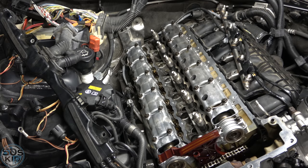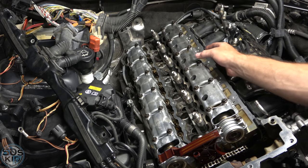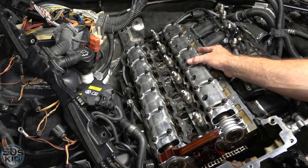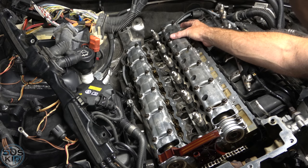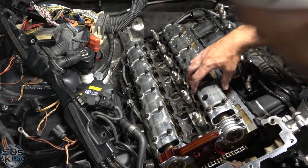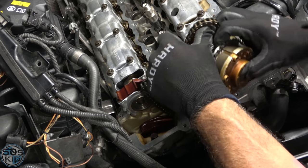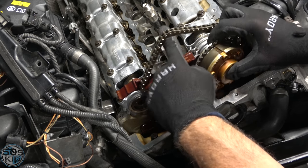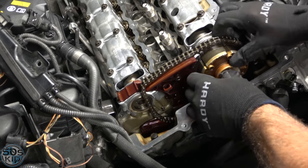I think these are totally fine. The fingertip test is the best — your fingertip can sense alignment on things; you can tell if something is off by a thousandth or so. These feel great. I've triple checked that all alignment feels good and all my rockers are in place. Everything is the way it's supposed to be.